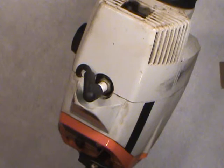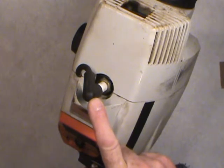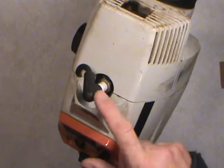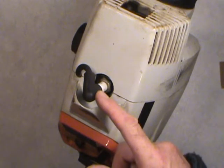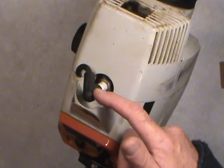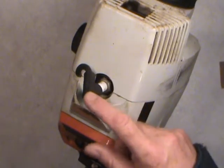This is just going to show you how you do the procedure, at least the way I do it — I've had some pretty good luck over the years and I'll mention little tips and tricks as we go along. The first thing you want to do is remove the spark plug boot. Make sure before you start that your engine is cold — you don't want to work on a hot engine and burn yourself. Get the spark plug boot off; it has the high voltage wire or high tension lead and the rubber or silicone cap that goes on top of the spark plug.